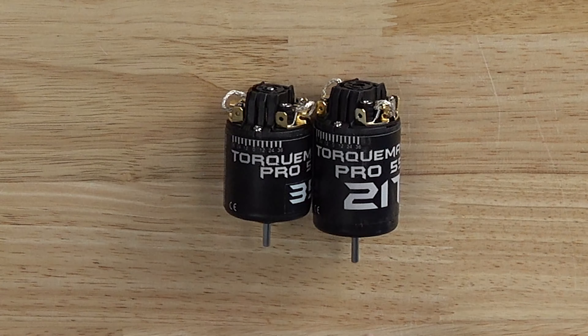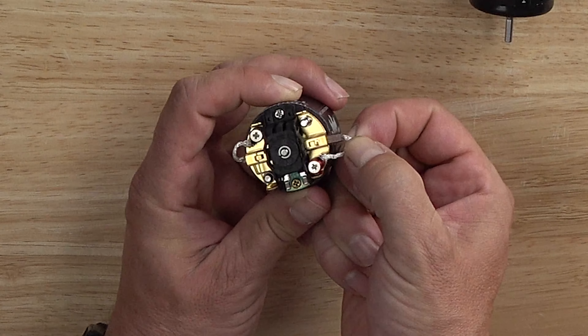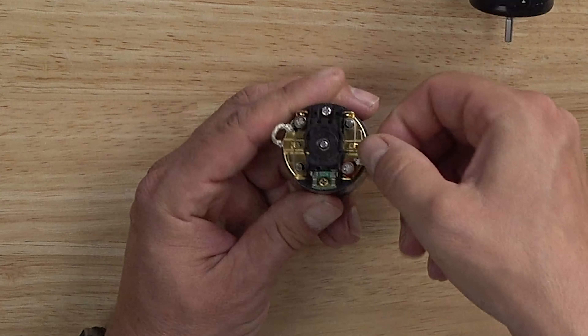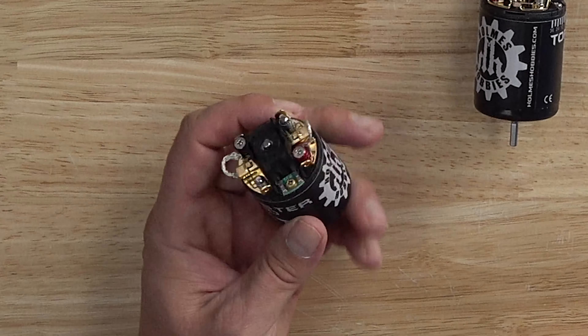We can also do that in the 550. I'm not sure if it's listed on the website. Let's talk about the actual quality in these. The magnets in these are the strongest in our catalog, barring any of our neodymium-style ones, but these have FB9 ceramic magnets — very high power. These are pretty much what the gold standard was back in the race days. They do have our gold-plated brush hoods, really high-quality, high-copper-content brushes. As you can see, they are fully rebuildable. You can throw a new armature in there, you can throw brushes in there — you can essentially have an infinite service life if you keep up on them.